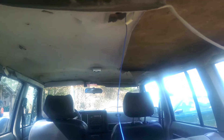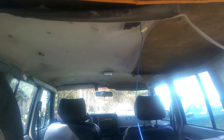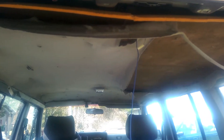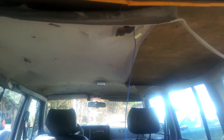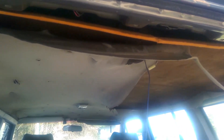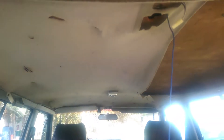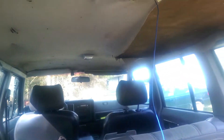Most people are probably going to complain that their lights don't work, or they work intermittently, or something to do with them not turning on. So the first thing you want to check is obviously that the bulbs are good. The front and rear cargo lights are all attached to the doors, so if you open any of the doors they should come on. They should also be attached to your headlight switch, so if you turn your headlight switch to the left they should come on. That's the first thing to check.